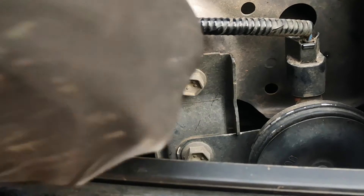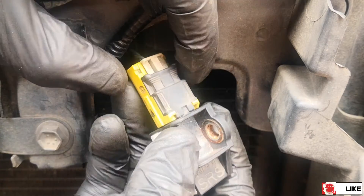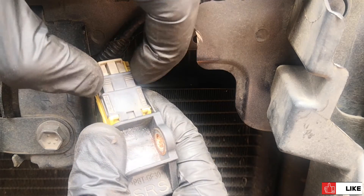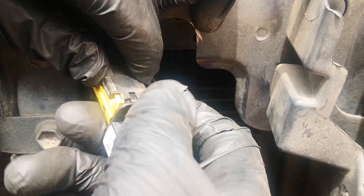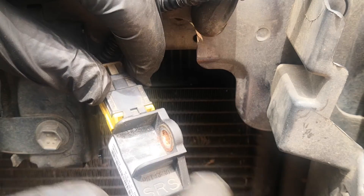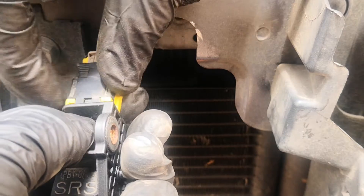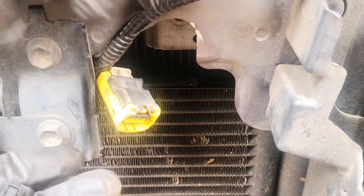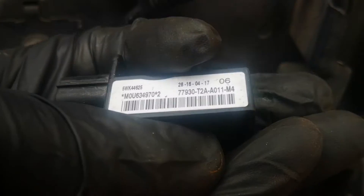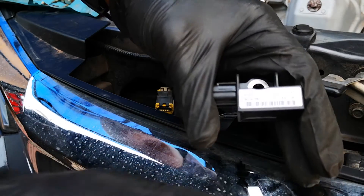So finally, this is out — the screw was really rusted. Once you get it out, to remove the connector, I'm just wedging it against the horn here. Then you pull back this piece — there's a fair amount of tension on this. As you pull it back, you pull on the sensor itself, all the way, then pull back. And that's it. That's the part number right there. I'll go ahead and replace with the new one.